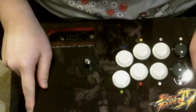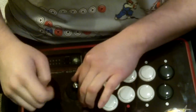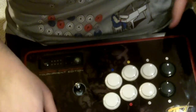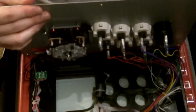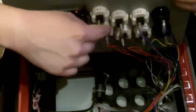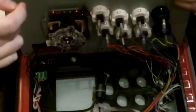Then we'll move on to the next step. After you've removed the ball top, go ahead and take off the shaft and the dust washer. When you open it up again, take a look at the different color-coded wires for each of the buttons — each button represents a button on the controller. You want to write down and remember each of the colors to the corresponding button, because you're going to be unhooking each of these wires and hooking up a different color button to it.